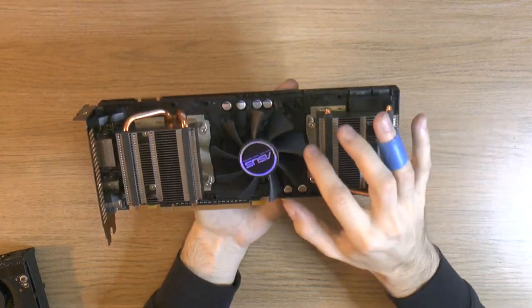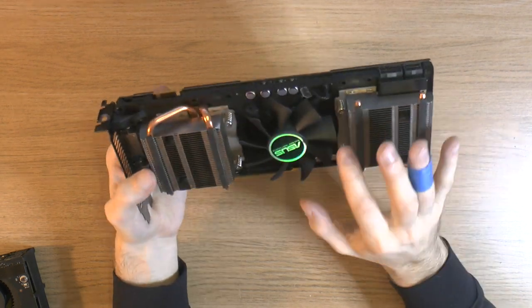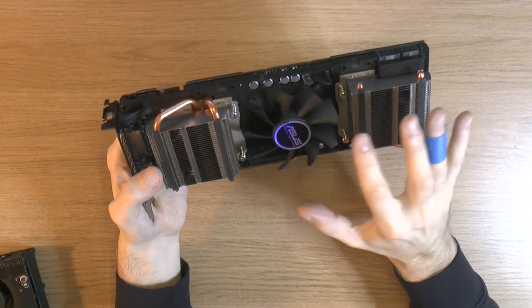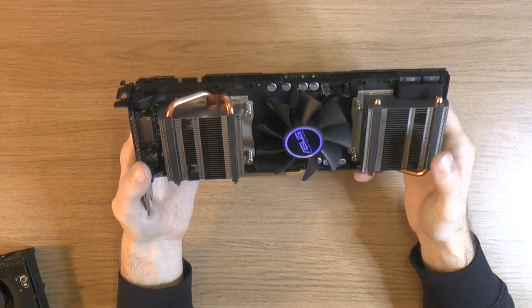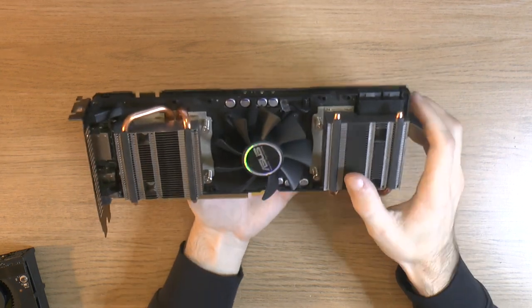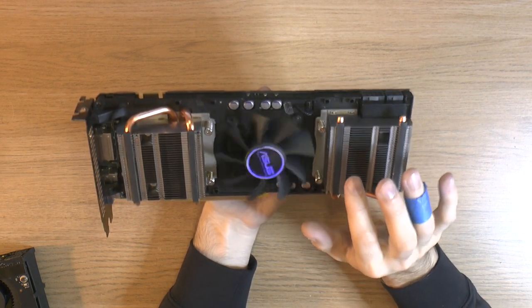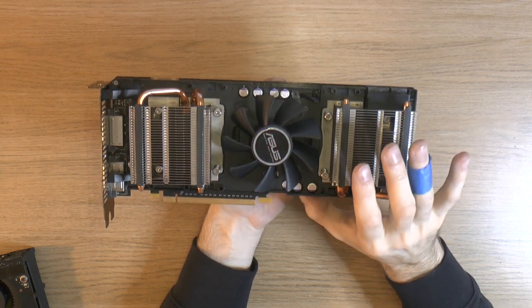All the GTX 295s are rated at about 289 watts. And the fan on this particular card idles at about 1500 and max is around 1800 usually. So a lot quieter, and it also runs about 20 degrees cooler, so around 60, while the older version is about 80. But this has inferior VRMs, I've been told, and they are different.